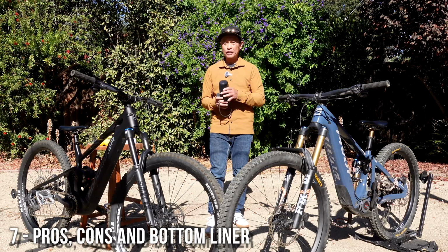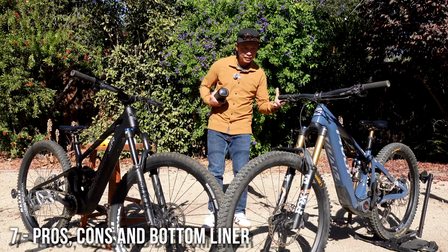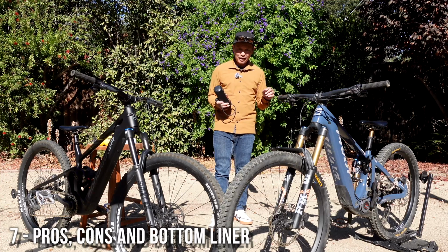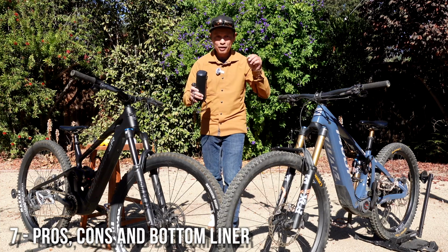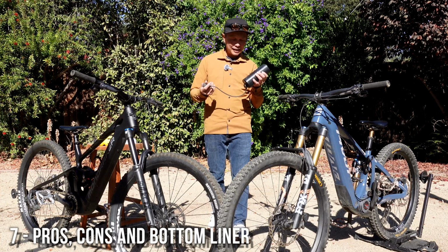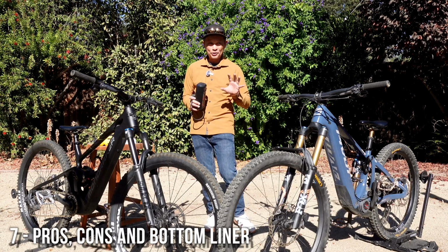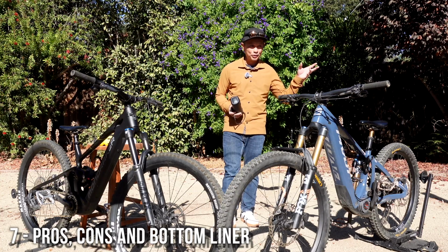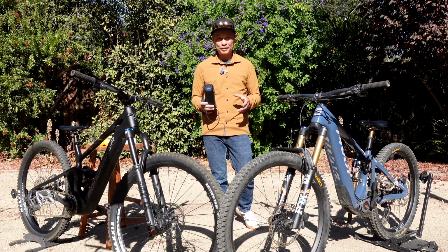The other disadvantage is charging. Now charging takes a whole lot more time. One process could take a lot more hours because you have to get in there at the right time when it's cooked, and then unplug it, and put it on the other one. So my recommendation, until we get a better system for charging: the Levo SL figured this out. You charge them both at the same time from one charger. But that would take a long time. The real solution for this guy is just get two chargers. When you get two chargers, they will charge at the same time. So your time to charge is actually the same or better than before, because you would have used your main battery less, and now that will charge quicker. Now you're doing parallel charging, so to speak.